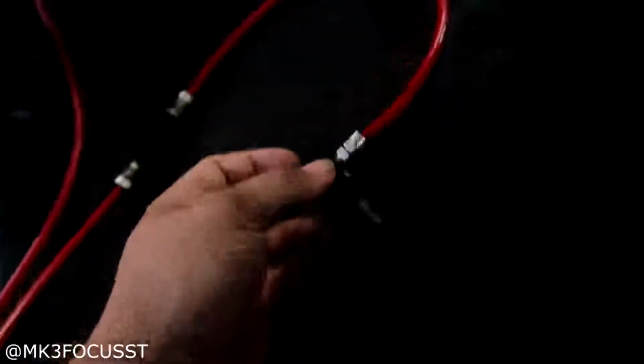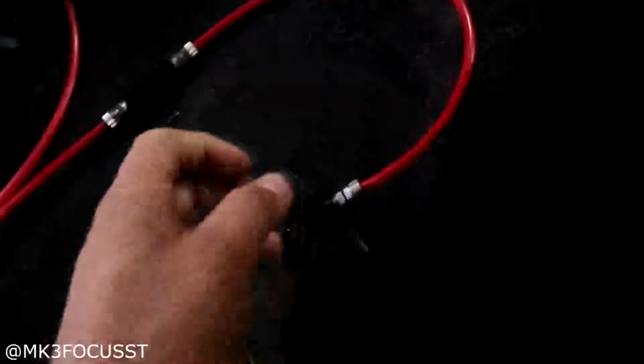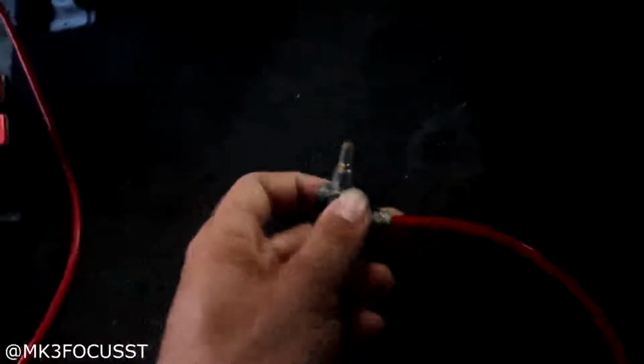And how to choose your nozzle size is in the instructions. I'm in between 200 and 400 horsepower. It says that for that power range you're going to need a number 3 nozzle. It says it on the side somewhere, and the kit comes with two nozzles, a size number 3 and a size number 5. But if you make way more than that and need a bigger nozzle, then just get that nozzle.